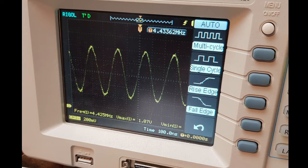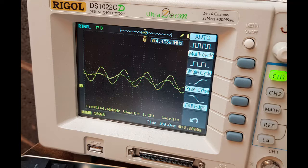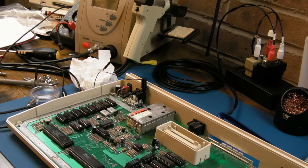So at this point I used the Rigol from Alice and Charles to scope around a few things. I looked at the PAL colour subcarrier crystal there, 4.433 megahertz, and even when the colour was glitching, it seemed solid. I was thinking it was a crystal thing. I photographed a few of the signals I was scoping around the colour circuit and the main clock. There did still seem to be a temperature related issue somewhere around perhaps the main clock. So the colour problem hasn't completely gone away.